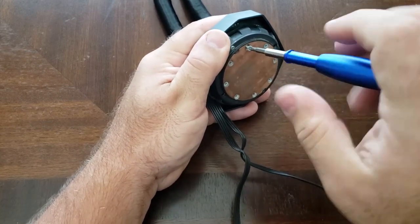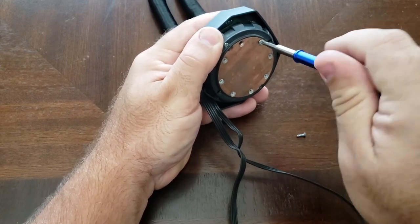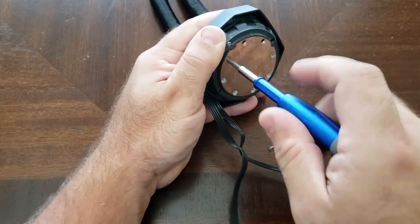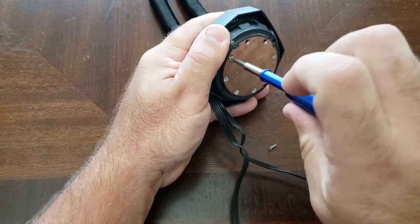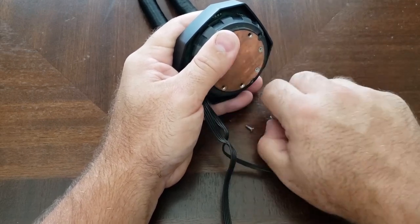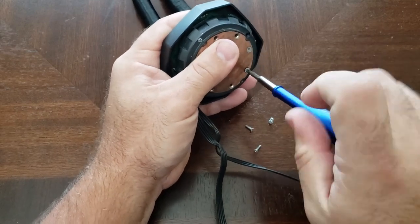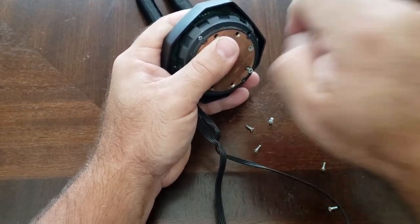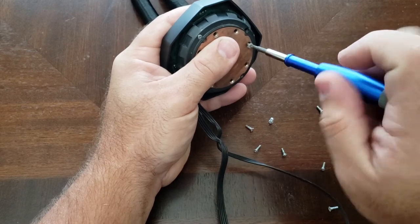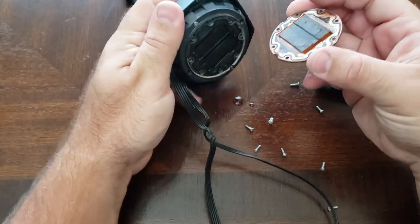Make sure you get a good quality screwdriver for these screws — they are kind of square and very easy to strip out. You'll need a lot of pressure and a lot of patience; push very hard and twist. Also, once you take this off it will leak fluid, so make sure you don't do this inside the case. Once the last screw is out, you'll need to pry this off.